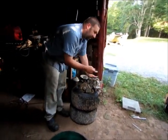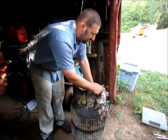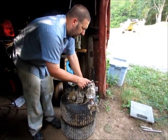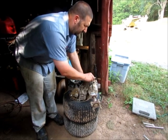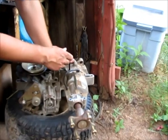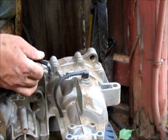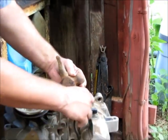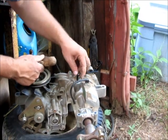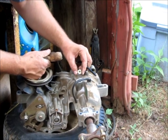A lot of people I've read about and talked to are taking off this plug right here to vent and refill the fluid or check the fluid. But this is the actual plug that you need to take out. Now this was not just hand tightened in there — I actually had to persuade it a little bit with my miniature persuasion tool. I just kind of stuck it in there and then tap tap tap lightly. Don't get too aggressive with it because it's just an aluminum housing and a little shallow allen wrench hole.